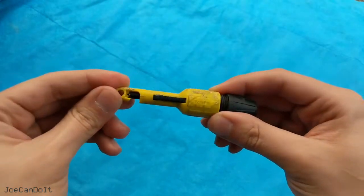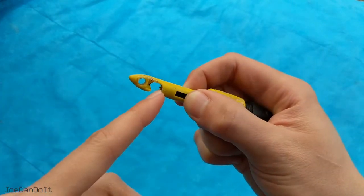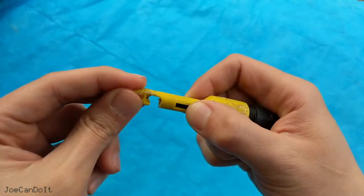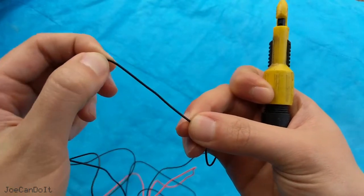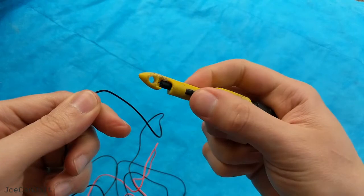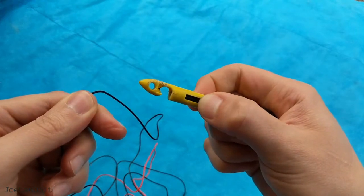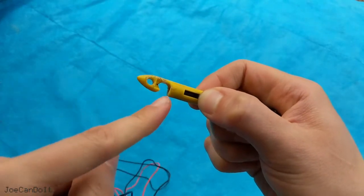This tool makes it super easy to test wires in your car, and the trick of it is with this thin needle. So let's say I have a wire and I'm underneath the dash, curious to see what the voltage on this wire is. Using this tool, I pull down these plastic clips, and when I do that, you'll see a little needle here at the bottom.